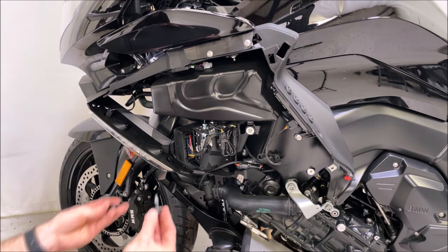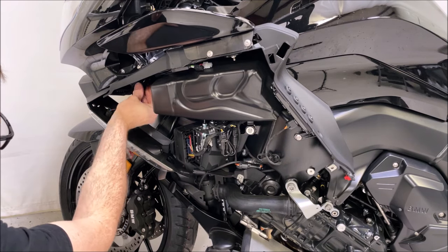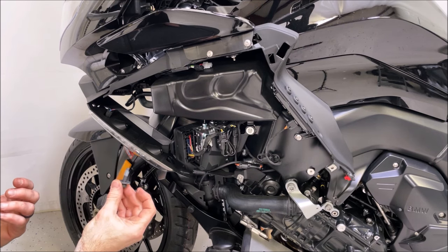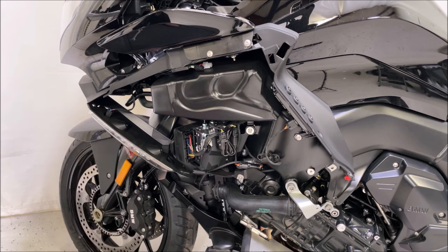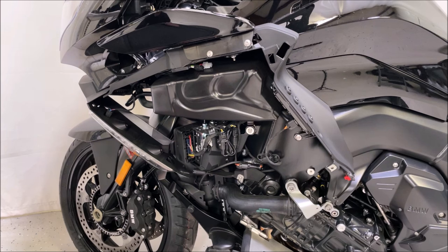For mounting, you'll use the bolt and speed clip from the kit. The speed clip goes up on that bracket — push it right on top. The bolt is coarse thread and grabs a lot, so a little WD-40 might help. It's a very frustrating location to get your hands into and see, so you'll want a headlight. You'll need a half inch wrench, preferably ratcheting, because you get very minor turns in there. It's definitely the most frustrating part of the installation.